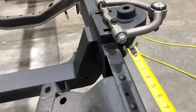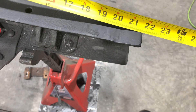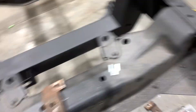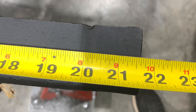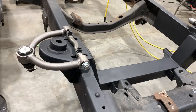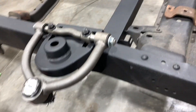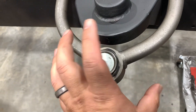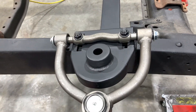Measuring now — control arms are in. From the end of the bolt, squaring up to the edge of the frame, we are at 21 and 5 eighths. Coming over to this side, squaring up the same way, we are at 21 and 5 eighths — a hair under. I think I can live with that; we're within a sixteenth of an inch on both sides. We can fix any remaining difference with caster adjustment — they shim underneath here and that will bring this forward, pivoting the whole thing. These are micro adjustments, so I'm pretty happy with this.